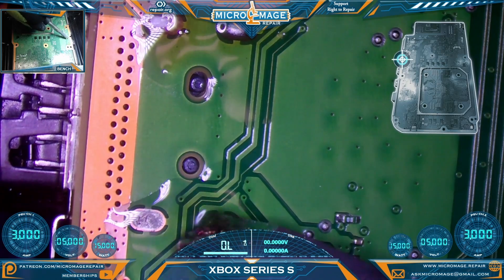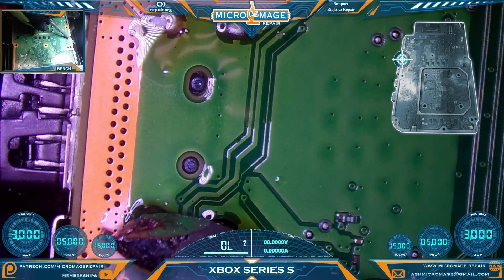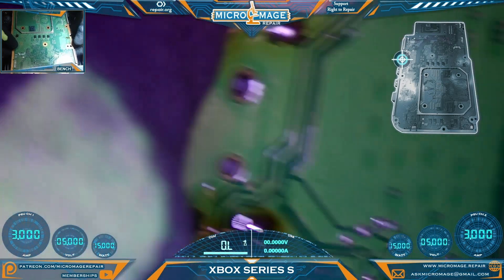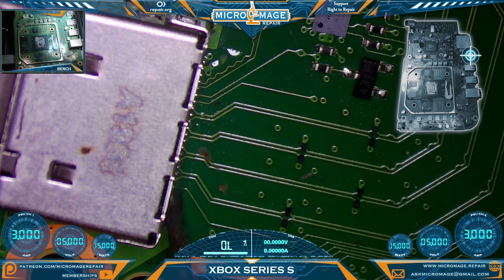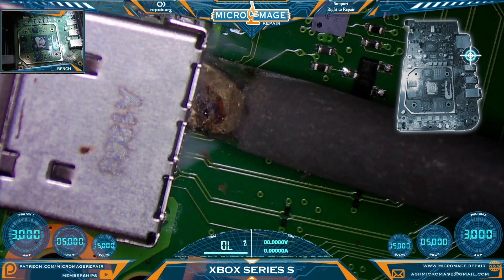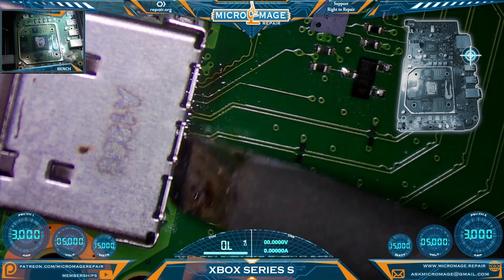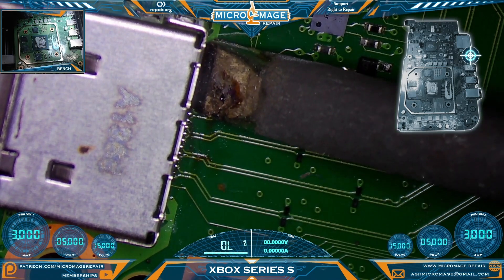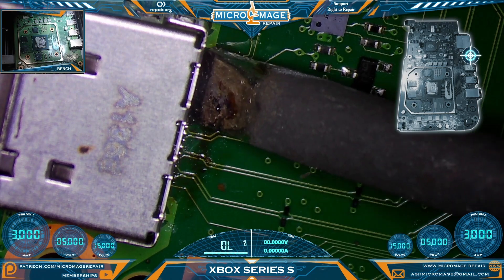My board heater is currently set to 170 — I don't have that on the temperatures yet. Okay, flip our board — flipping our orientation. We're also going to low melt these pins. Like the Series X, this console has hidden anchors and there's nothing we can do about those, but the low melt will make sure that we don't do damage elsewhere, particularly right here.